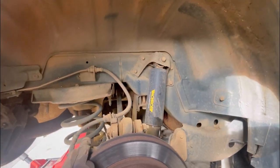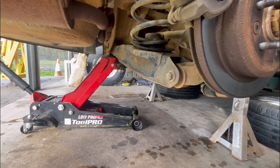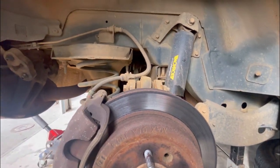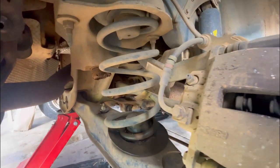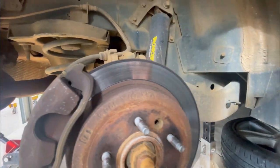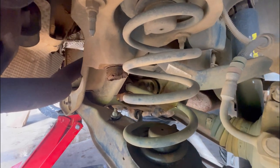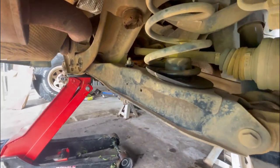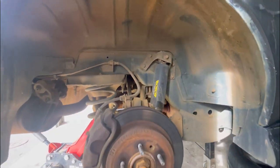If you're doing your diff at home on the floor, a lot of people have diff bush issues and it's not that hard to do at home. I've seen comments online saying don't even try it at home, but it's really not that hard if you've got a few tools. The hardest part is actually pressing the new bushes in and maybe getting the old ones out, but if they're genuine old ones they're pretty easy — they only have a fiberglass or plastic housing with the rubber bush so you can get them out quite easily. For pressing the new ones in, I've just got a bit of threaded bar and two bits of steel plate to use as a press tool.